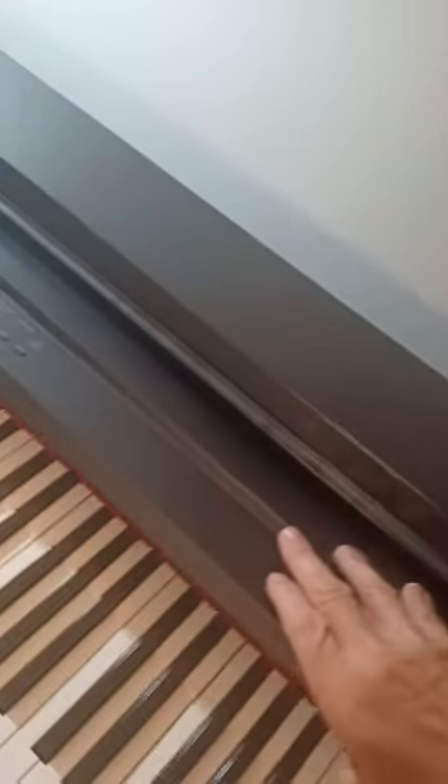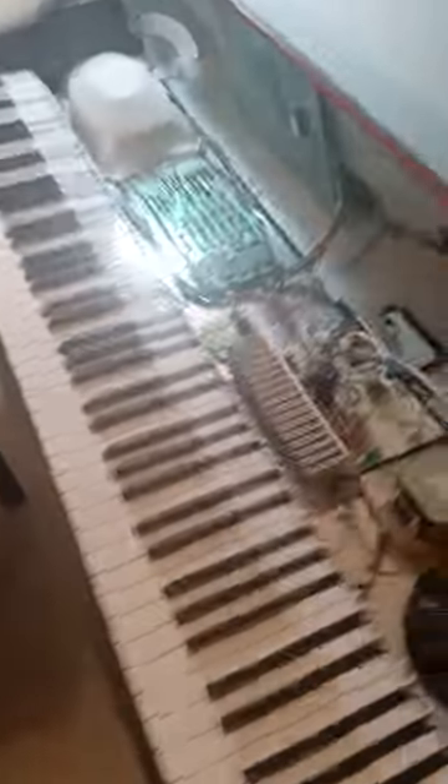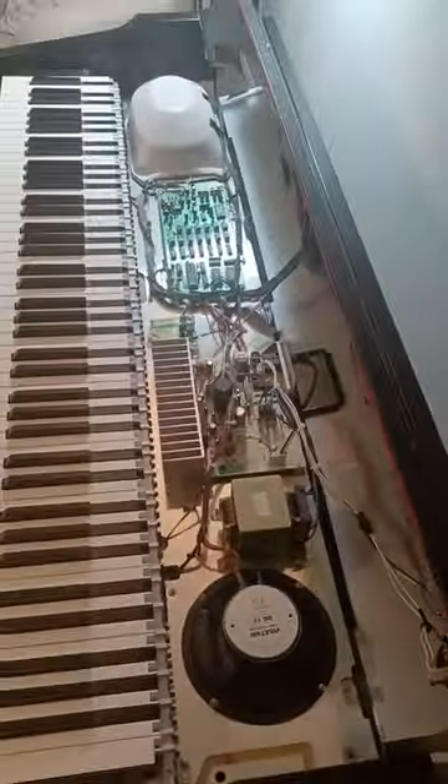If you get up underneath this thing — there's a washer right here, that's where the screw was. Here's your corner, it's straight across from the speaker grill. There is a long screw in there with one of the washers that have tangs on it that actually embed themselves in the wood. There are a couple others like that out here, so don't get the wrong one — you want the one straight across from the speaker, and the same on the opposite side. So those two screws and then the two in the back — four screws total — and then this whole thing just hinges and pivots back. Don't remove a lot of the other screws in the back because they bolt other things that will cause you problems.